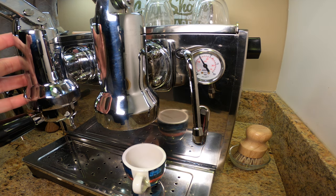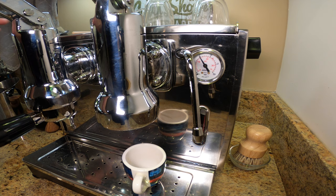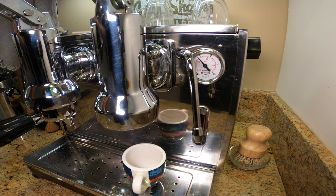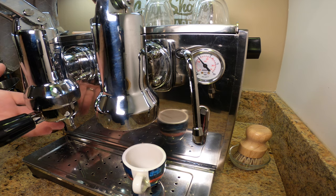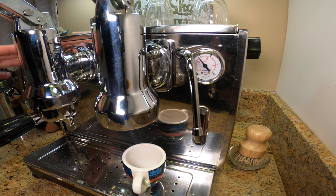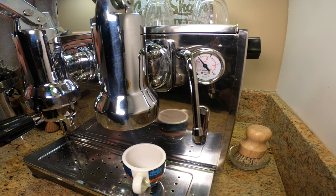If it turns out you really like that and you want that to be a permanent setting, take off the cover, adjust the pressure stat, and you will always have 0.9 bars. But this is a great way to just fiddle around temporarily. Let's say maybe I want to try 0.8 — you could try that and test it, as long as you have your machine turned off so it doesn't reheat, because these things do heat up very fast. If I had it on, it would go right back up to 1.1 in an instant.